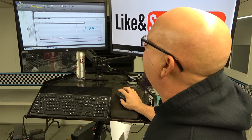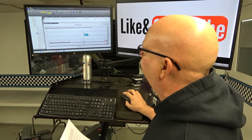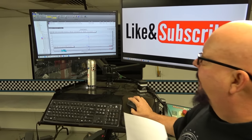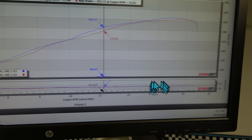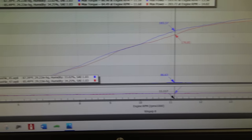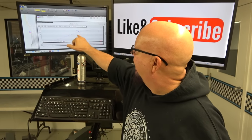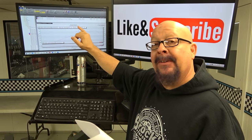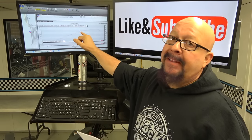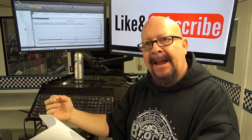So I didn't even pursue additional with the no stacks, because if you see, this air fuel line is straight as an arrow. It's a dead ass overlay from the past before. So there's no tuning I can do to make this go away. This is a mechanical issue. It's a problem. And the only way that we can repair it isn't with a tune. It's by changing other mechanical parts.